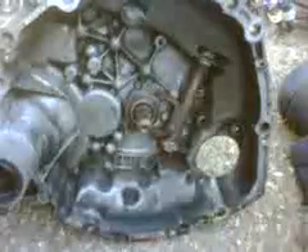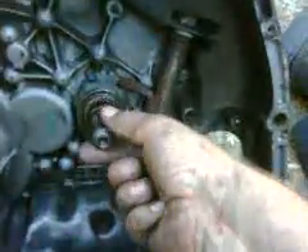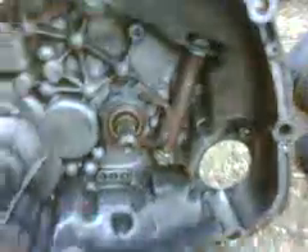I'll try to run the motor at slow speed without securing all of the bolts and make sure everything is lined up — leaving a bit of movement to shift things up and down, left and right. And you've got to make a coupling up. The idea initially is to get the clutch off, though I need star sockets rather than star screw bits to do that. The idea is to take the centre out of the clutch, which should fit on here, and then somehow couple it up to the motor.